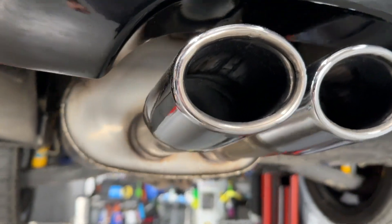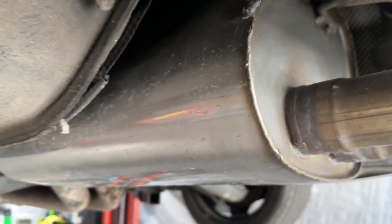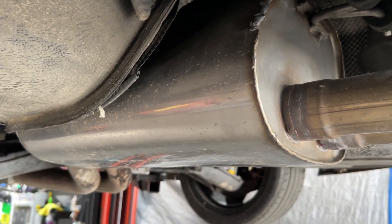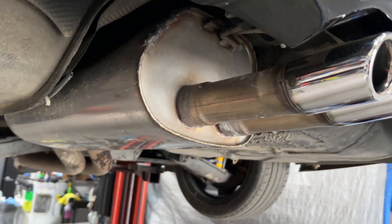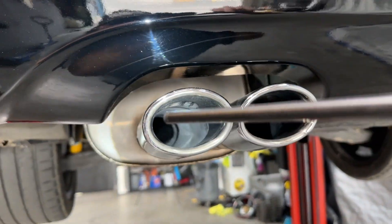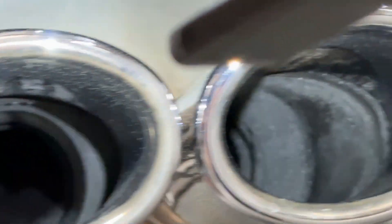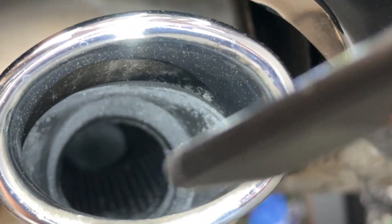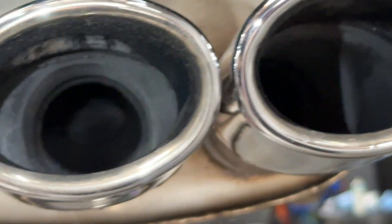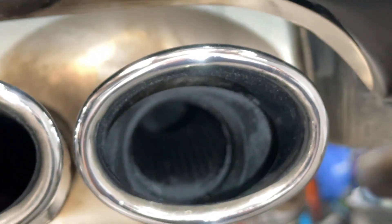If we look up here, you can see it's cut open - there are some weld spots on it, a little ugly but you never see it from the underside. They cut it open, took out all the sound deadening material, but I don't think they modified the pipes inside - those are the original resonated pipes. You could replace those with straight pipes which would probably be too loud. Gutting your muffler is what has been done here. I'm very pleased with the sound - it's much louder than stock with no drone, all pros and no cons.